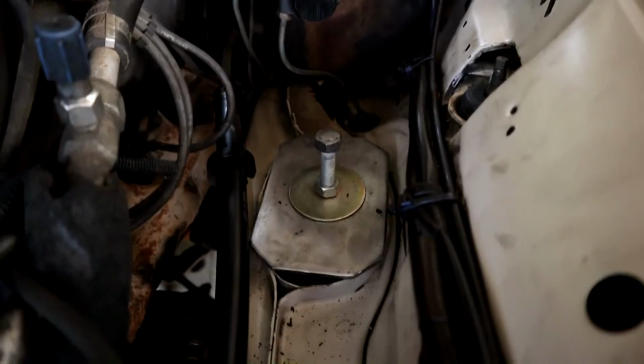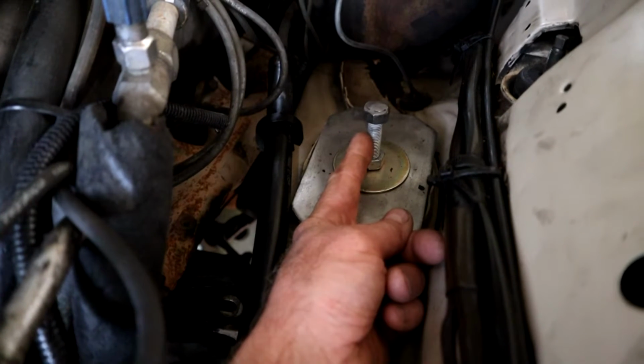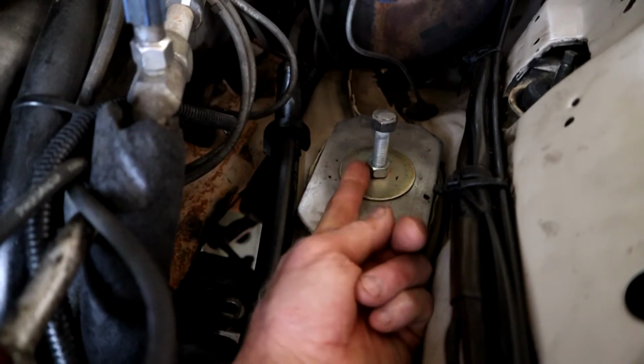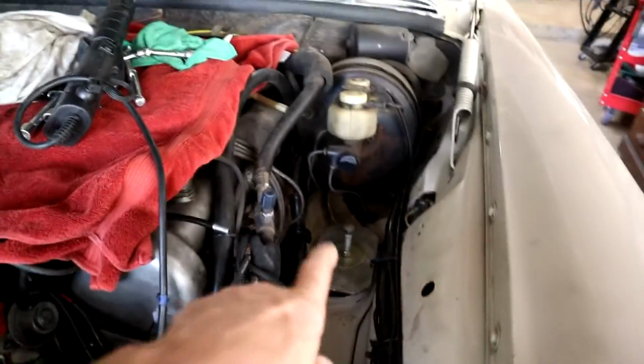And what I'm thinking, I've got enough space to lower the subframe like this, put the mount in, bring it back up, and then do the other side. So let me get in close and I'll show you what I mean. So here's our support plate on both sides, one on each side. And what I'm going to do, this bolt obviously goes through the subframe mount into the subframe. And what I'll do is I'll back this nut off so it rides up this thread, and essentially lowers the subframe on each side. And obviously we're supporting in the middle of the subframe, but because of the subframe shape it could start teeter-tottering and stuff like that. So I figure if I held it on one side, it should keep it in control.